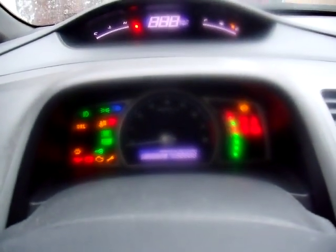So we'll do that and you will see what happens. There's the tachometer needle going right the way around doing its full check. As you can see all the lights do continue to flash. Now I'll move it up here and we'll do it again so you can see what the digital does — you can see that both temperature and fuel it's checking all of the bars to make sure that they are all functioning as well.